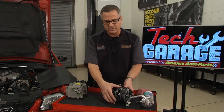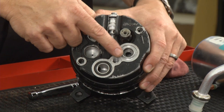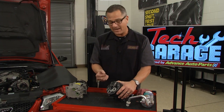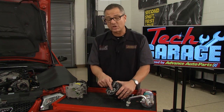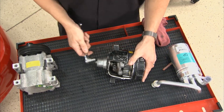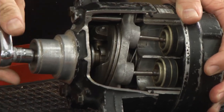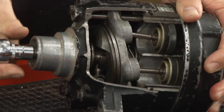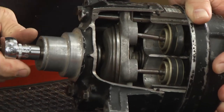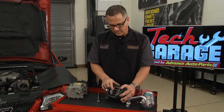The compressor has a cutaway, and if you look right here, there's an S and a D. The S stands for suction — remember where it was pulling in on that low side and the gauge was dropping. The D is for discharge — that's the high pressure side. How does it work? There are pistons inside of there, just like a car. On the intake stroke they're coming down, pulling the refrigerant in on the suction side. Then as the pistons go on the other side, it's actually pressurizing and pushing the refrigerant out. This is a wobble compressor.